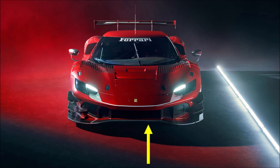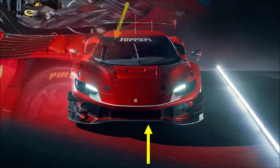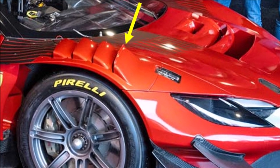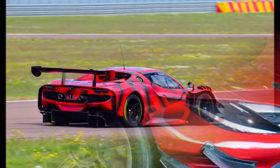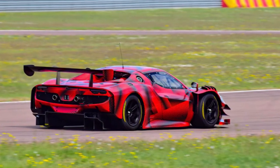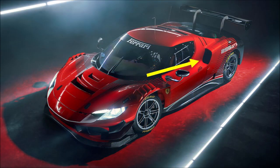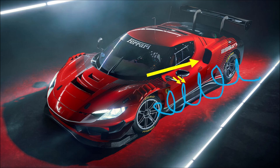Like always at Ferrari, the center of the splitter is raised dramatically to get more air underneath the car and to stabilize downforce under braking. The louvers on the front wheel arches are extremely high and have an additional gurney flap on the first element. The structure behind the front wheel is cut back to allow better exit. To not catch this low energy air, the rear inlets for the intercoolers are positioned higher, and the wing-shaped mirror stays help to guide clean air to the inlet and keep the front wheel weight down.